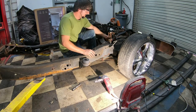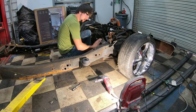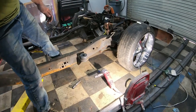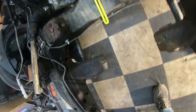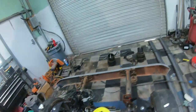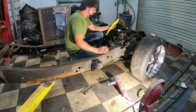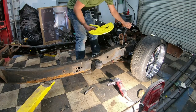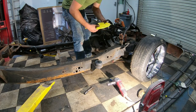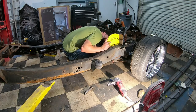But looking at it, where the lower control arm is mounted on the inside of the frame, there's already a plate welded on both sides — I'll show you right there. I'm going to use this exact reference point, using that meter there to measure and get it exactly where I want it. Using this to get my point, I'll move my toe arms up out of the way and put it on top of the frame.